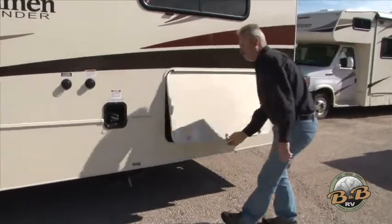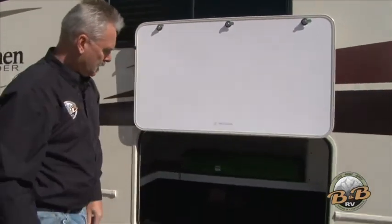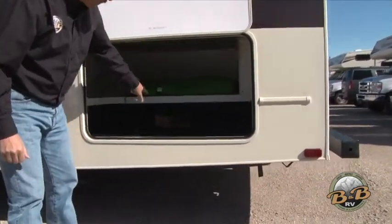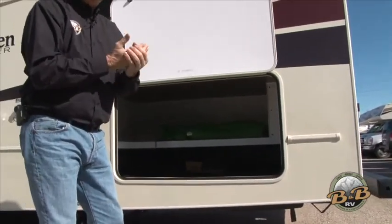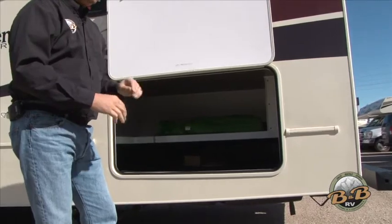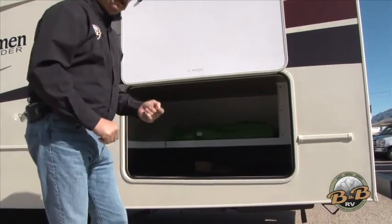This is the larger storage compartment on the outside. There's a little clip on each of these doors to help hold it up for you. This compartment has a pass-through so longer items will fit in there. You're going to have four camp chairs and a set of blocks for leveling. Anytime you park for more than about 15 minutes, you have to get level for the fridge. The fridge has to circulate its fluids, and the blocks help you do that. Whatever side — left, right, front, or back — is low, just put those blocks down and pull up to get level.